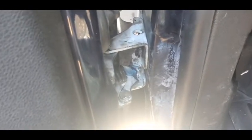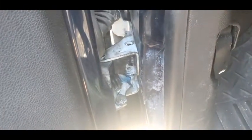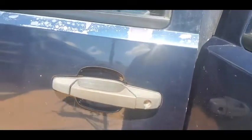And here's a little trick that I use to eliminate sag. Move your hydraulic jack more forward, jack it up, snug your bolts, or tighten them, and I added a little grease, as you can see there. So everything's tightened up, and I guess the only thing left to do at this point is close your door. And it looks good. Job well done.